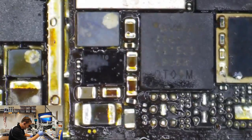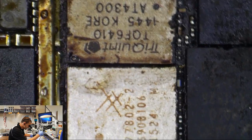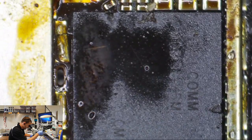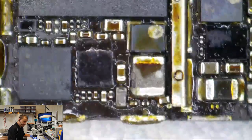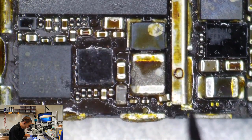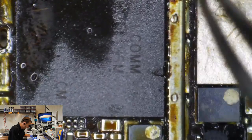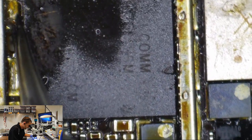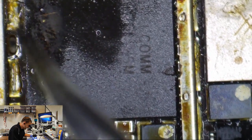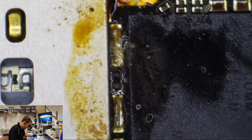There's a short to ground somewhere. I told the customer I cannot fix their no signal/no service issue, and they're okay with that — they just want the phone to come on. I think it's data they're after. This company had a really hard time taking the shield off, so they wound up knocking some components out of the way. This little ground pad here was actually ripped up from the board.